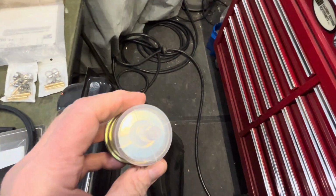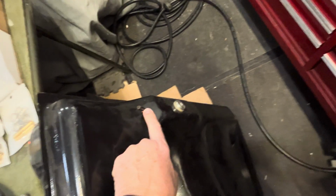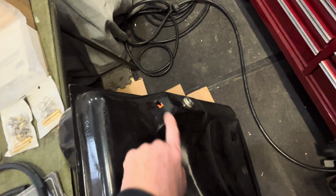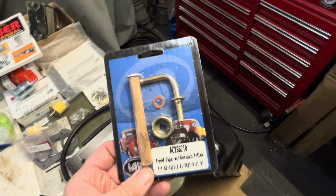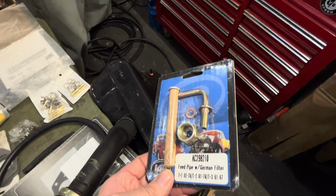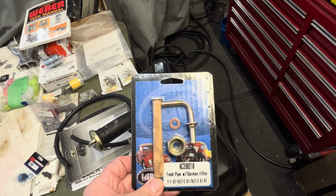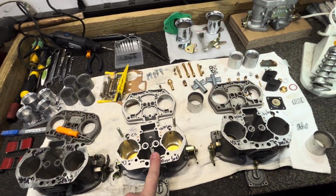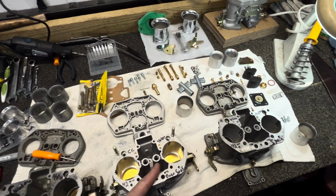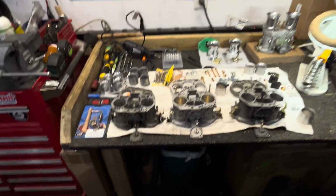So we get into these fuel filters. We have our smaller ones and our bigger ones, and all your fuel is coming from this little pipe here, which is very fine. If you're running maybe up to 150 horsepower, and a lot of your driving is with your foot three-quarters into it for more than 35 seconds to a minute, are you dumping all your reserve fuel out of here? And we all know when you have the same amount of air and less fuel, it goes lean, and that is a cutting torch, because now your engine is nice and hot and kaboom, it all goes.